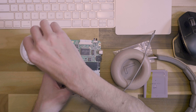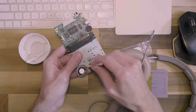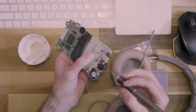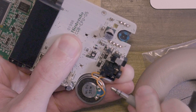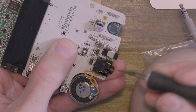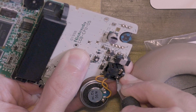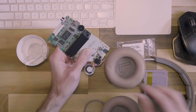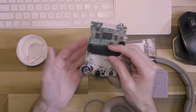I'm also going to try cleaning the headphone jack. The way I do that is with a lot of alcohol. When you put in a pair of headphones you can see a little metal piece engage and disengage. You want to get something sharp, like a razor blade, in between that little piece of metal and just kind of scrape it to clean away any corrosion. That definitely is something that always needs to be done. I think the speaker's fine; it seems to be working.